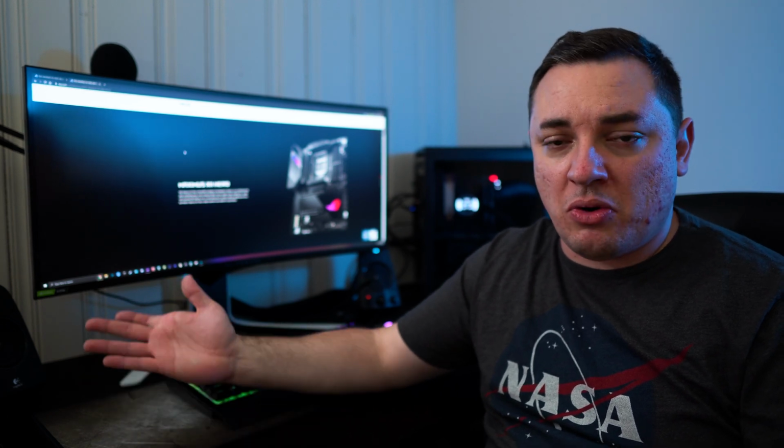Monty here. Today's video, I just wanted to go over the BIOS update I got to do for my motherboard, and there's probably a lot of BIOS updates right now for a lot of the Z490 boards as well. I have an ASUS ROG MAXIMUS XII Hero, so that's what I'll be updating today. The last version I got is probably about 2 months old. I usually try and stay on top of the BIOS updates, just because since this is a new board and since I'm overclocking, stability is kind of what I want, and every time they update these BIOSes with a new version, they show usually like Intel microcode updates, as well as like stability fixes.